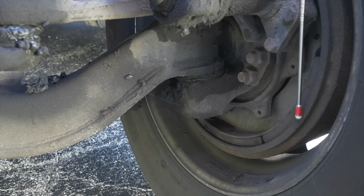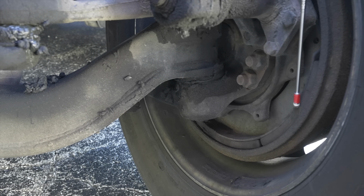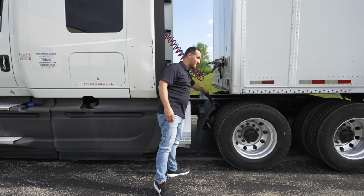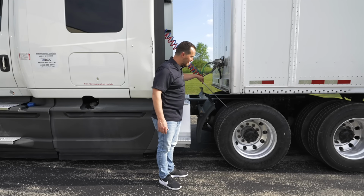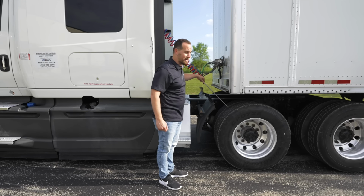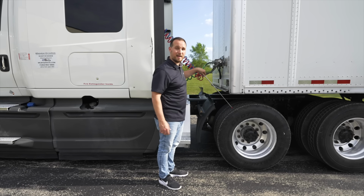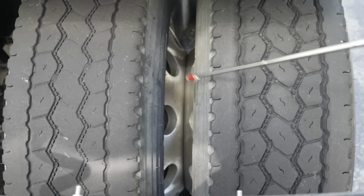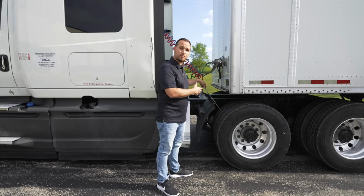The brake drum, it's not broken, not cracked, on secure. Next to the brake drum, we have our brake linings or pads. They're not broken, not cracked, on secure. There is a sufficient amount of padding to be safe. Our side wall on the tires, they're not broken, not cracked, on secure, no cuts, no leaks. The front of the rear tires, they're not broken, not cracked, on secure. Tread depth has to be 2/32 of an inch at the minimum. In between these tires, by our bud spacing, there is no dead animal, no debris, no foreign objects in there.